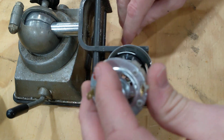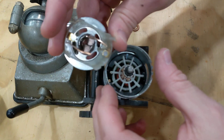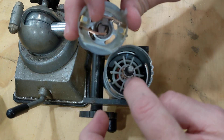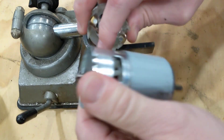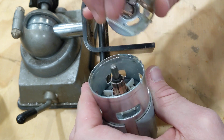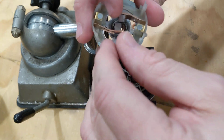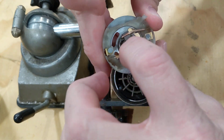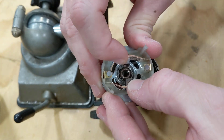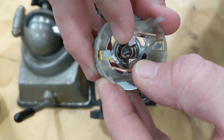You can only do it once easily. This is the inside of one of your motors. What you have in here is two motor brushes that rub up against the center commutator. If you pull it out, you can see the copper portion on the motor — that's what makes the electric contact with the vehicle and helps determine the speed of it. So these motor brushes are pretty flat on the contact area. When you spread this out, you can see you have a pretty flat contact patch onto the armature of the motor.